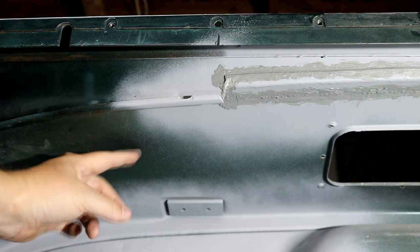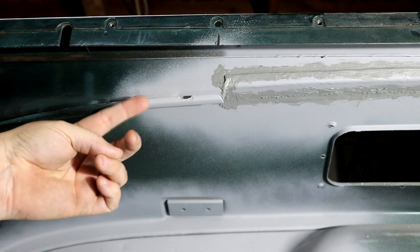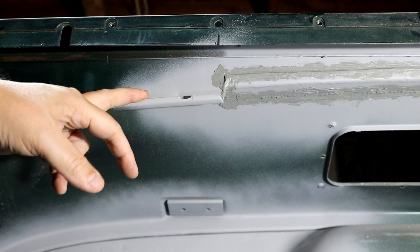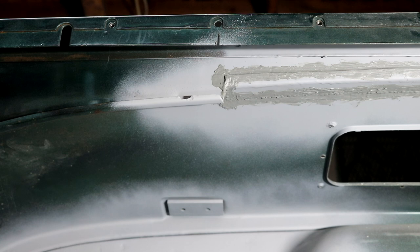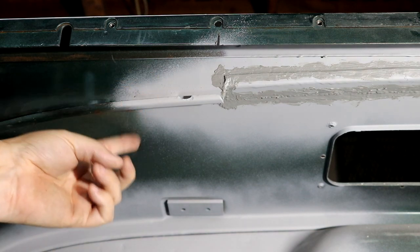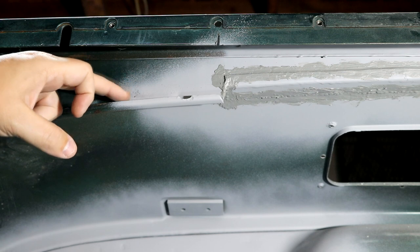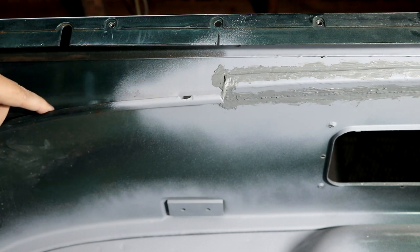This lower cowl section, it comes forward and then comes down and J-hooks around like this, creating a little, I'm assuming, a little water channel to catch any type of water that would get in this area through some holes or something and run it right down the A-pillar where all these Jeeps have problems. But so this lower cowl, it has this little J-hook, and then the upper cowl, or whatever this upper frame piece is, it just comes down, sits down in it, and then is spot welded at the factory to make these joints.